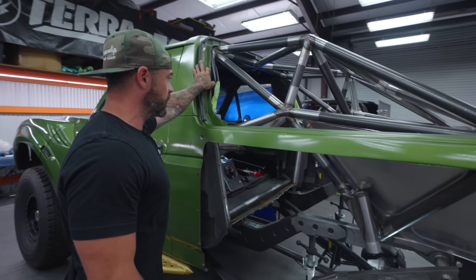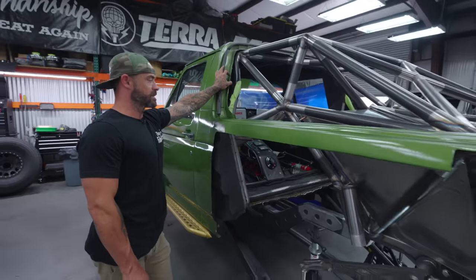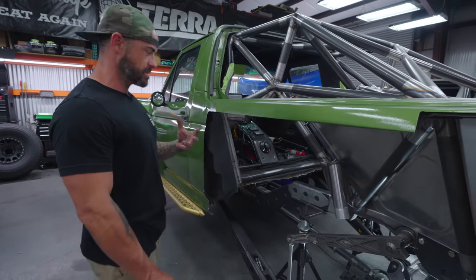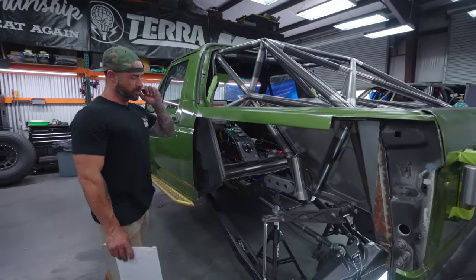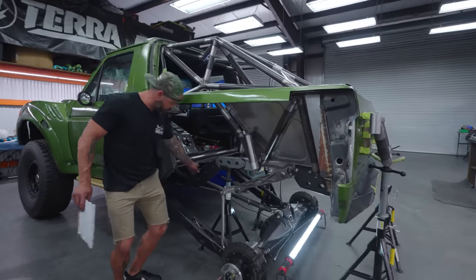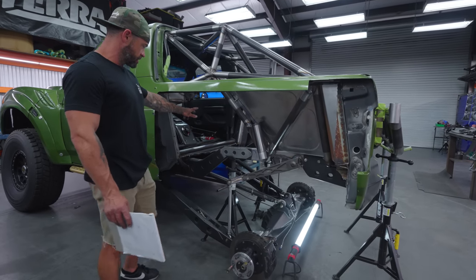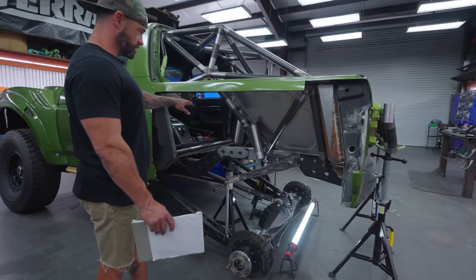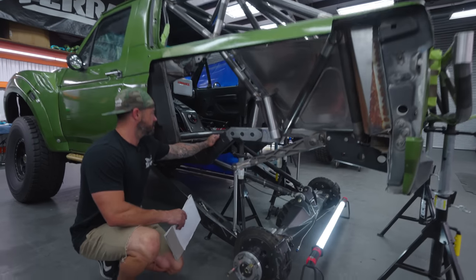For myself, I don't enjoy welding like I used to — it's more of a time thing because it takes so long and you don't see the progress. The instant gratification just isn't there. But all of that is complete. Bump stops are done. The sway bar is moved — it used to have provisions up higher, but it did some weird stuff with the suspension at compression, got really close to the upper links, and we freed up a lot of up travel.